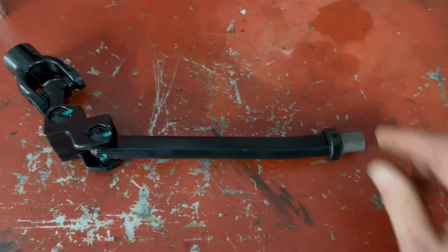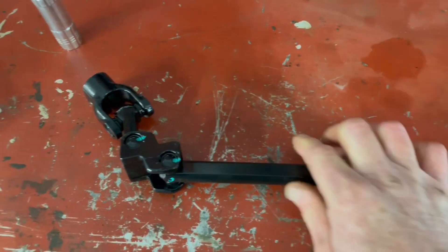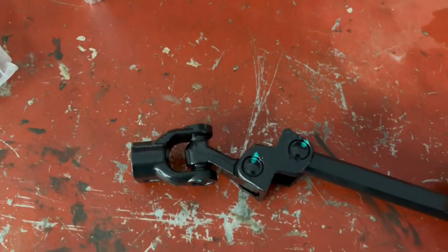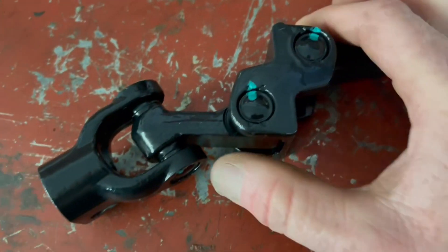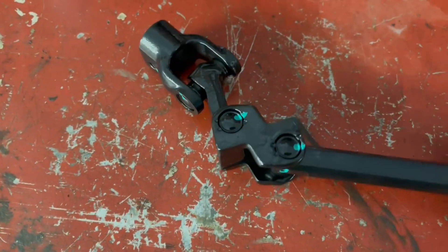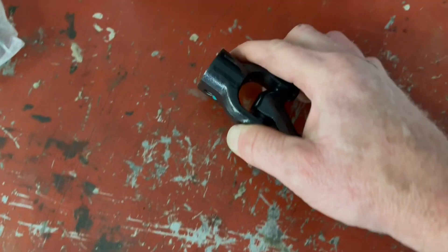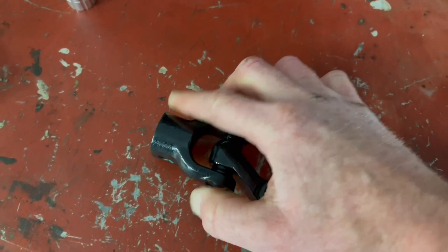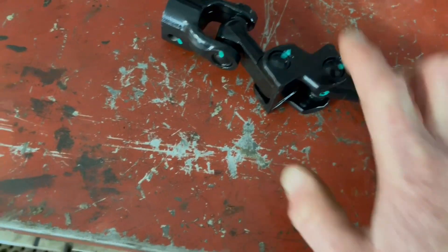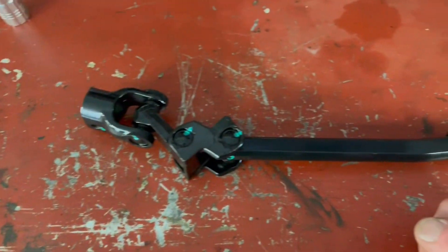It's very simple to do — at least we hope it is, I've never done one. Here's the new part: you'll see there's a little bit of a bend here; this is the part that goes into the steering column U-joint. Down here there's this little double flexible section where this piece flexes separately, this flexes separately, and then this piece here flexes separately again. So you've got one, two, three joints in here that can potentially go bad, which is I believe what the problem is on the old one.